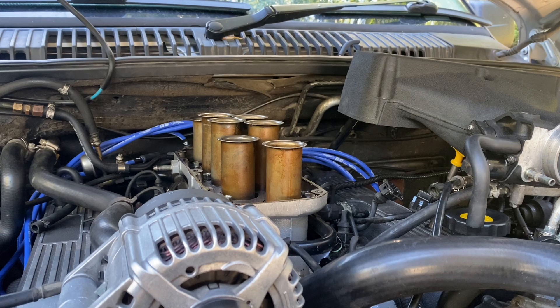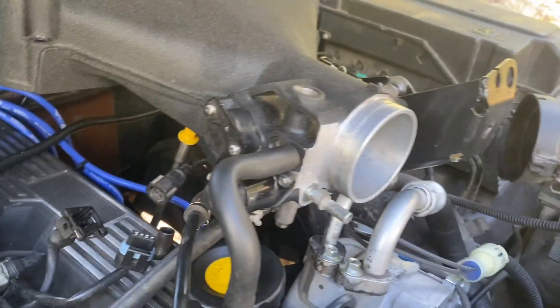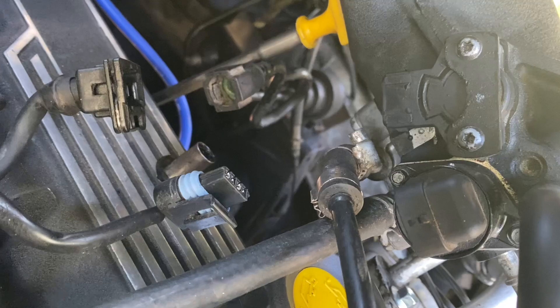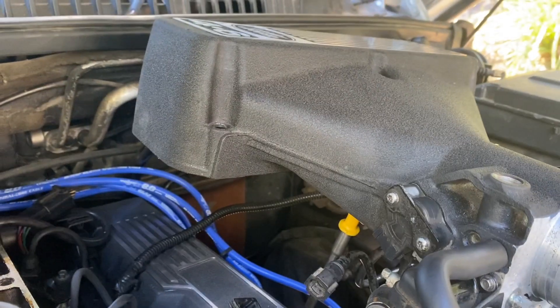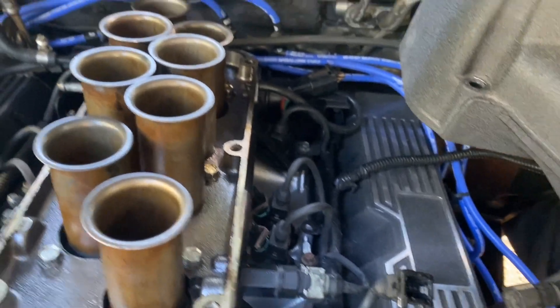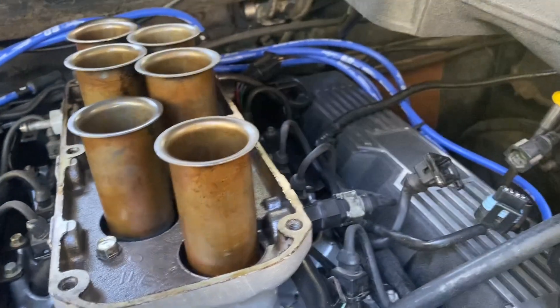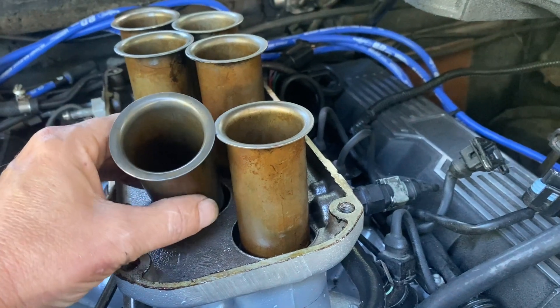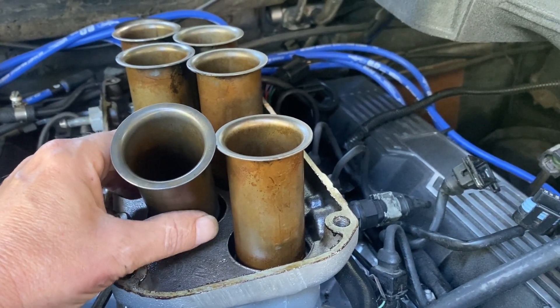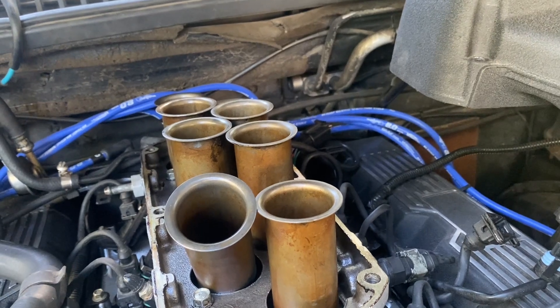Just put on the base — the ones that are loose I'll fix. While I'm on the subject, that's the top piece over there. There's a pipe on it, it's a real pain. That little pipe there is a nuisance to get to. I'll try and work around it. I'm going to try and get that pipe off so I can move it out of the way. I spent a lot of time painting that, I don't want to ruin it. One, two, three, and there's three more along there. I'm going to get that off — once I can get that out I can get to the fuel rail. I just wanted to show you what they call trumpet being loose. I wonder if that's the source of my little rattle on the top of this new engine. We'll find out.